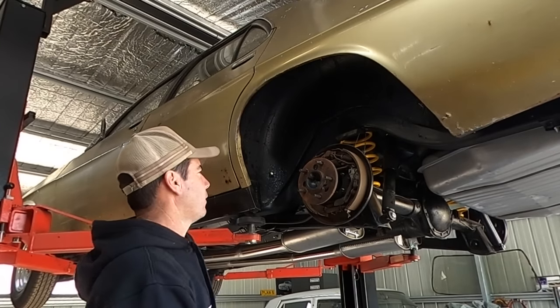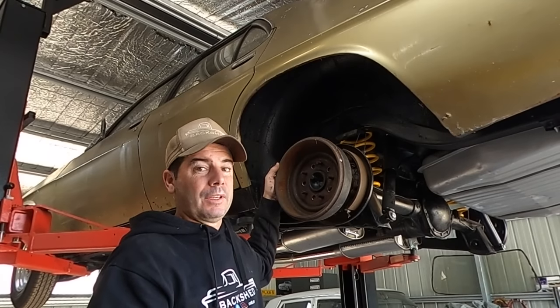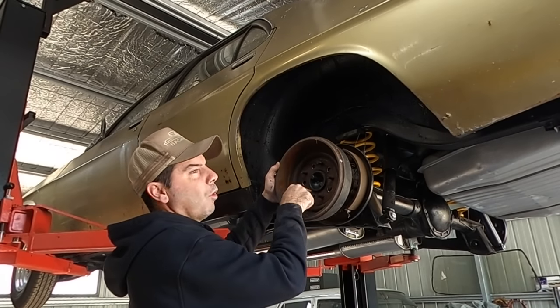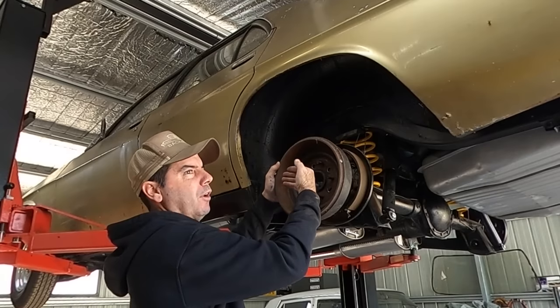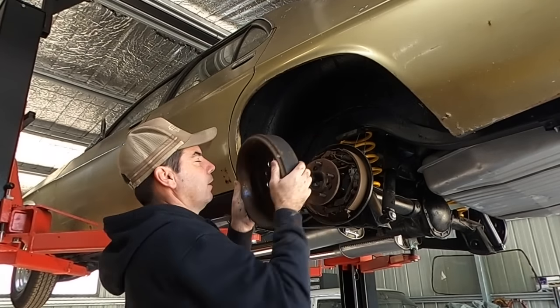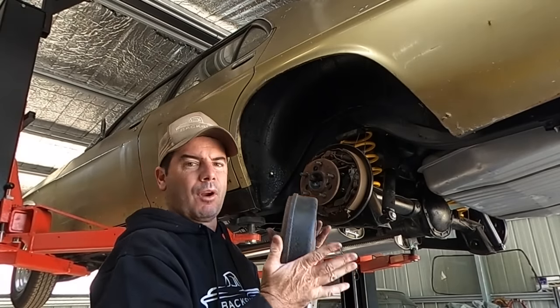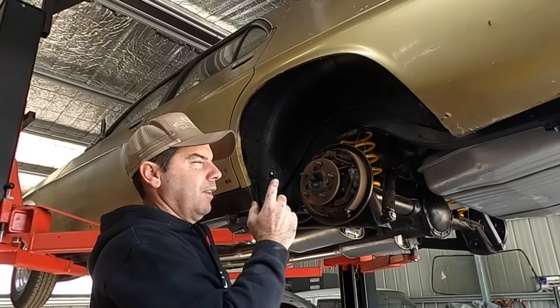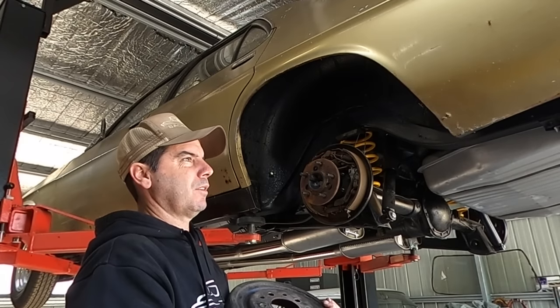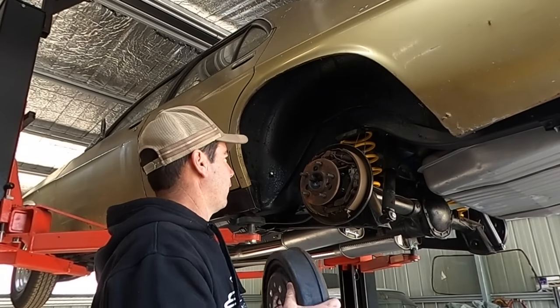The one pitfall is, and I know this because I did it, don't just put two on, put all five on and try and keep them the same distance. Otherwise, if you just got two on and you're slamming at it, take your drum off and you've got two lumps here. These are pretty heavy and robust, but the old banjo that was in the EH, I did actually dent it and then had to bash it back. They were never the same.